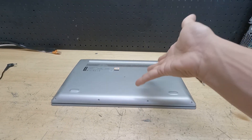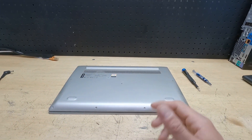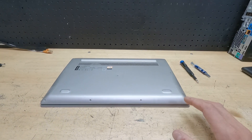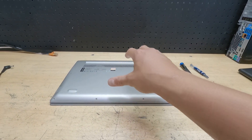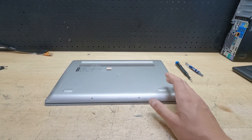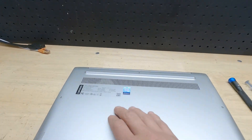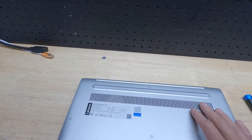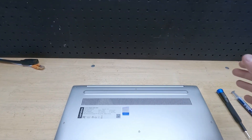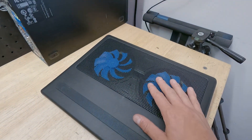One of the biggest things I get in the garage is 'my laptop is overheating' - especially in warmer weather. When people come in I always ask: how do you know it's overheating and what is it doing? Sometimes what you're actually doing can affect it. I've had people come in with brand new laptops saying it's overheating, and most of the time they're using it on their bed or lap, suffocating all the ventilation trying to suck in fresh air. Usually it's as simple as just putting it on a table, or getting some type of mount that won't block the vents.